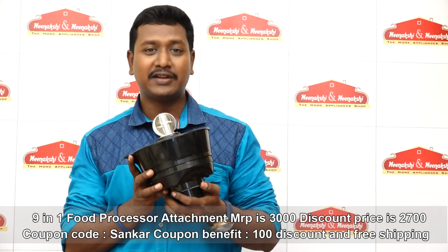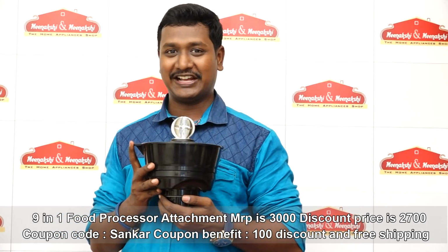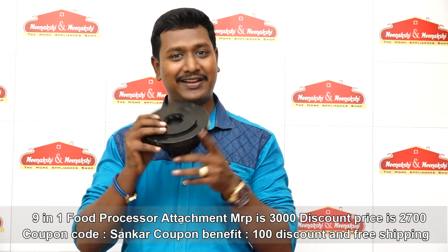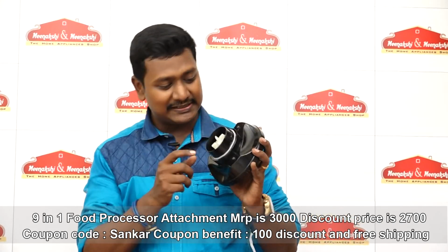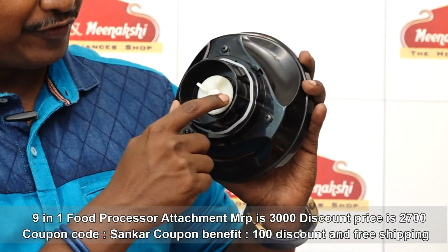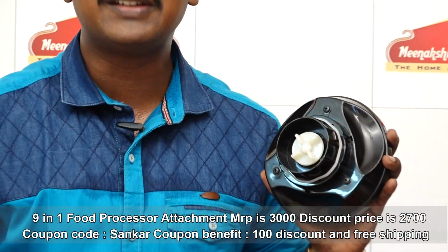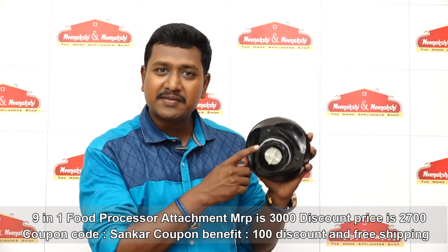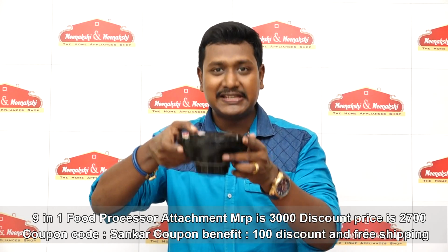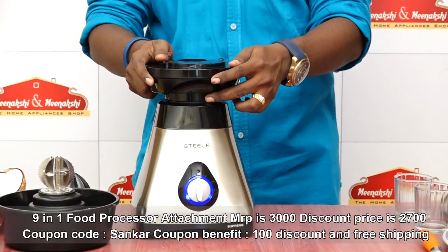This is the attachment which is called the Meenakshi and Meenakshi coconut scraper and citrus juicer attachment. This attachment comes with a gearbox. The basic unit is the gearbox. This gearbox consists of a four-teeth coupler. This four-teeth coupler sits in your old existing mixer grinder. Here comes the silicone gasket, and this attachment is to be seated in your mixer grinder. See, I'm fitting it in a clockwise direction.